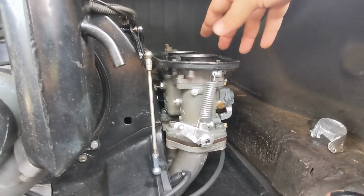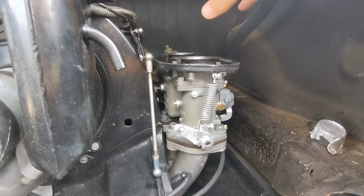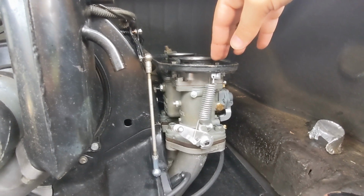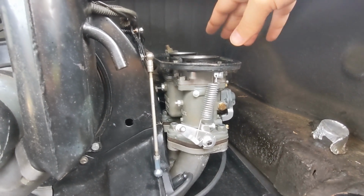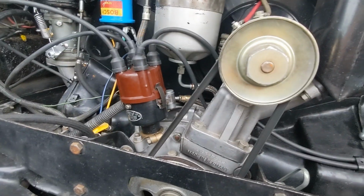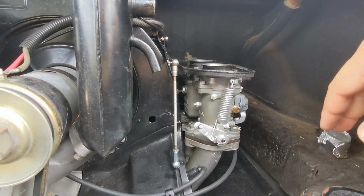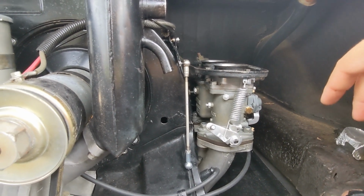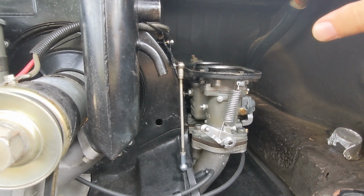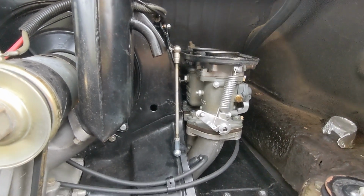And so now it's nowhere near where it was, and now there's a bunch of hesitation right around when you're actually pushing the accelerator down. So got to do some more tweaking. I do have a second distributor that I bought, because I noticed the timing is kind of jumping around. So there's a lot more tweaking to do. It's almost like 2 steps forward, 1 step back, but now I feel like it's 1 step forward, 2 steps back. But either way, we'll get it done.